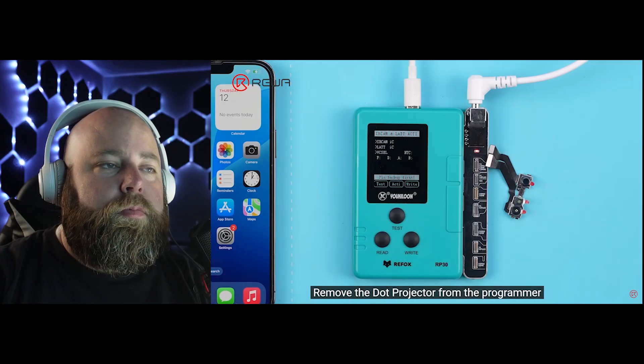In the past there have been other solutions like this, and you needed to follow each step just like this, step by step, otherwise you aren't going to have a successful repair — and you might have already caused enough damage to make it so you can't do anything about it. For example, if you had fused the component without having read the data first, that's basically game over, because now you don't have access to the data. You have to back that up before you do that one step, and you also need to fuse it before you connect the tag-on flex that will have the data to it. Otherwise, you won't be able to access that data because it's not bypassing the MOSFET. Remove the dot projector from the programmer.